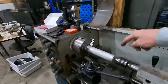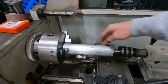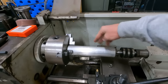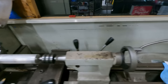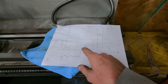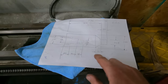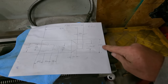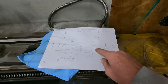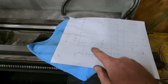All right, so luckily the guy gave me, or sold me, enough to do two of these. So in case I screw it up and don't know what I'm doing, I got enough to do this side's one, or I can cut it in half, throw it away, and do this side. I'm not a machinist, but I think the OD down here does not matter. The OD right here where it's going to pilot in the crankshaft matters. 1.805 is what I'm going to try to get the entire piece, then worry about this step, and then worry about that, and then I guess you'd flip it around and start the literally boring process of that.